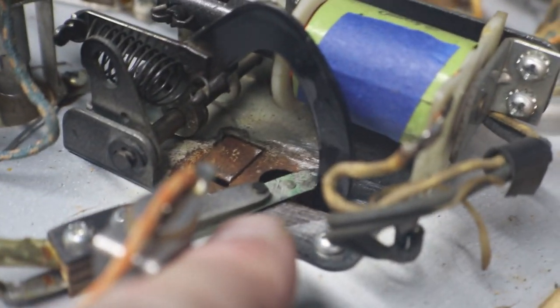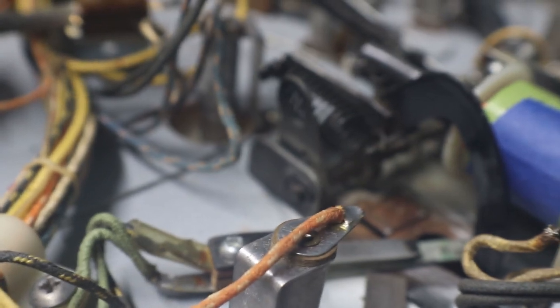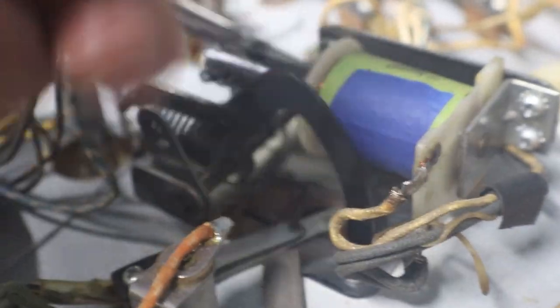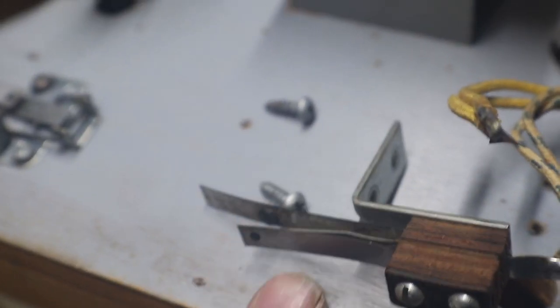Now see, when the ball falls in the hole, you can see the leaf switch, that little nub sticks down in the hole and the ball comes in, balls on that, and it lifts up, makes contact, and it rings up your points, and then kicks the ball out. That's all there is to those. But now we'll have a nice, good-looking hole. Okay, I'll get the other one put together, and then we'll move on to getting this leaf switch straightened around.